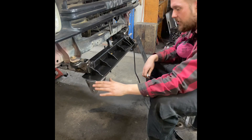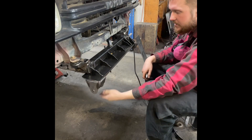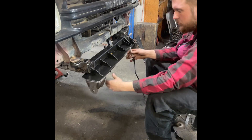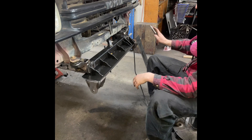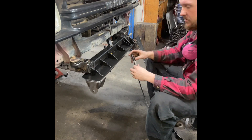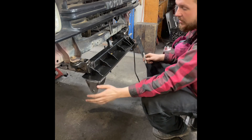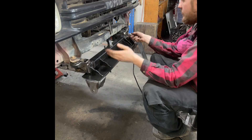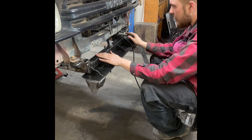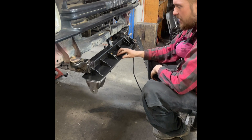What's up guys, today I'm reviewing our Walker Fab Lab front hanger cinching cage kit. This takes your trail gear front hanger and moves it out a little bit, so you have a really nice platform to build a bumper off it and you're getting maximum out of your solid axle swap kit. First off, you'll tack your lower plate - the key plate - to the bottom of the chassis. You're going to want to make sure it's square, so you take a clamp and clamp it.